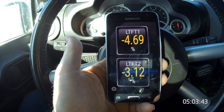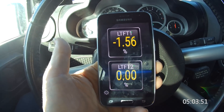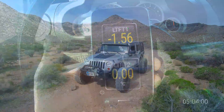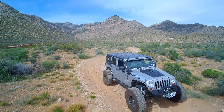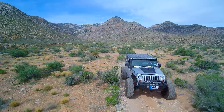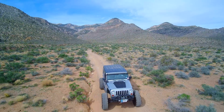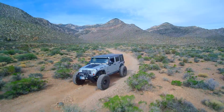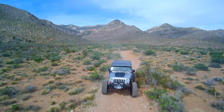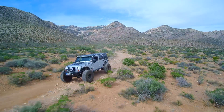Long-term fuel trims are really important because they're basically the culmination of everything going on in the operating system. You want to see the long-term fuel trims as close to zero as possible. This vehicle doesn't have a whole lot of miles on it, so it's still going through its learning process. The long-term adaptives are the culmination of short-term fuel trim. Many times a second, the computer is making corrections for fuel. It's not doing it using a lookup table like in the old days — this is a coefficient-based operating system using dozens of coefficients: intake air temperature, intake manifold vacuum, vehicle speed — multiplying them together on the fly to come up with a fuel strategy. If that fuel strategy is right on the money, you're going to see these long-term fuel trims at zero.